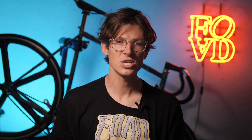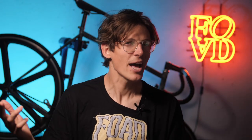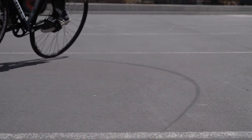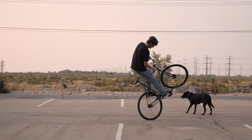There is a limit to this — you don't want to pump your tires past the manufacturer recommendation or you run the risk of them blowing out. They'll also be really hard, so all the energy is going to be transferred through your bike. If you're doing tricks, I'd recommend running bigger tires if you can, but that costs money. High PSI will also help with skid tricks, giving you less friction during the skid. Another reason is that you'll be doing a lot of quick turning movements, and if your PSI is too low, the tire can deflect off the bead of the rim and feel really weird and wonky.